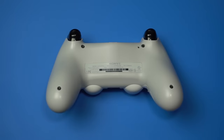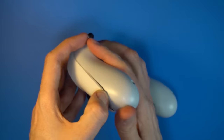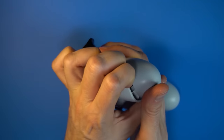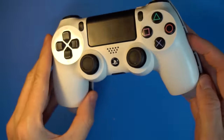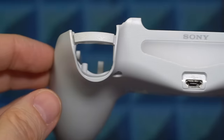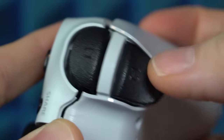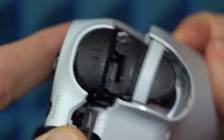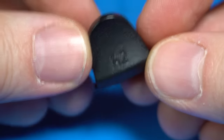We need to go deep inside the controller. Lay the controller upside down on a soft surface. I don't recommend doing this around carpet as tiny pieces may fall off and become lost. Take out the four screws on the back with a small Phillips screwdriver. Gently separate the two shells — there's a ribbon cable between them so don't pull them too far apart. My version has a little strip of plastic that goes between the shoulder buttons; carefully slip it out through the R2 and L2 buttons.